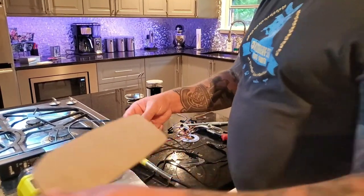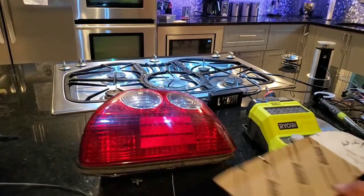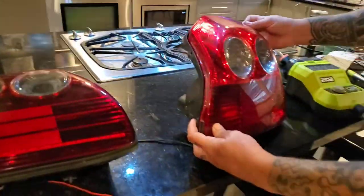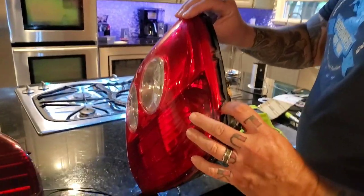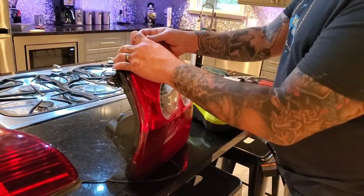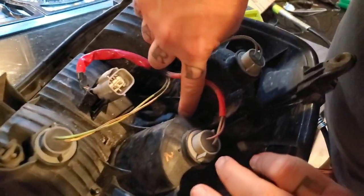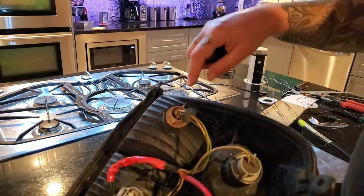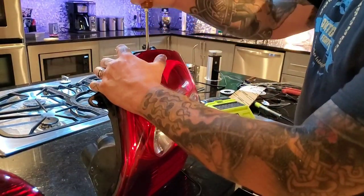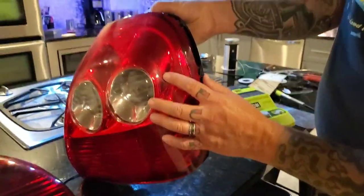I made a cardboard template to go over here. You can make it for one light and then just flip it for the other one, then cut out your metal — that just covers up the old lights. So what we're going to do is pop this apart. Be very careful of these tabs — I accidentally broke this one so I've got a new lens I'm going to put on. These tabs will break really easily. Once you get those pried back, there's a screw in there that you've got to take out. There's also a screw here that just holds in a little clear lens. These tabs on the side are already broken, but they're about $45 at Toyota and they still have them.